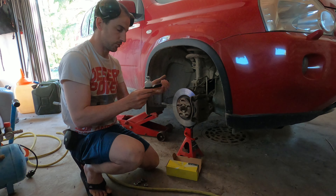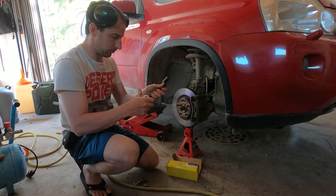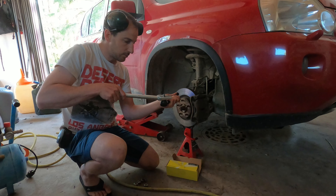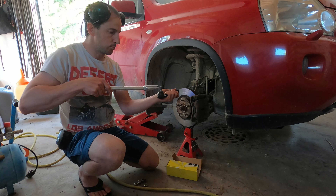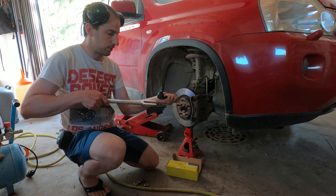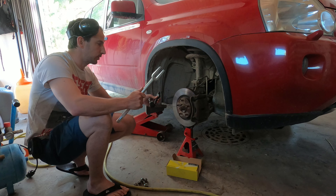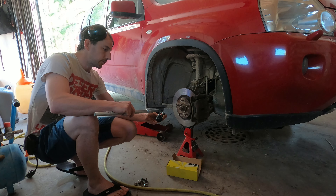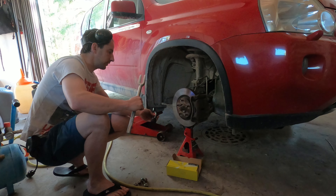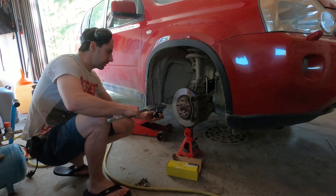It does have a side, so you have to be careful to buy the correct side. Basically this tool will come here and will be hammered in, separating that part from the support. The only downside is that doing that breaks the seal underneath. If you break that seal, the part will go bad really quickly. Alternatively, you can sometimes get it loose by tapping slowly from the top, or you have to hammer it hard from the support side, and then the cone shape makes it pop out.